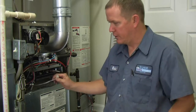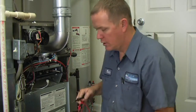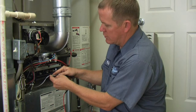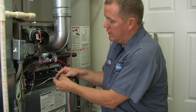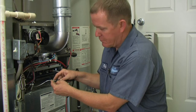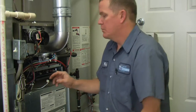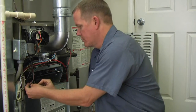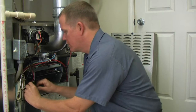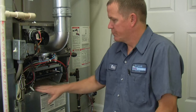Next thing I would do would be to ohm out the igniter. Both ohm meters on ohms. You would take your meter and just touch one to each prong. 80 and under is basically what I shoot for. This one's reading 48, so it's pretty good. But on the big igniters — the older style igniters — anything over 80 I recommend replacing. 85 or so, I recommend replacing it; it might go bad. Anything over 100, for sure it's going to go bad. This one checks out okay.